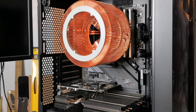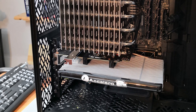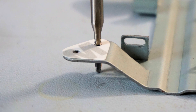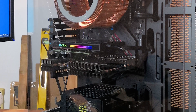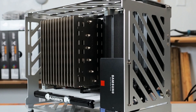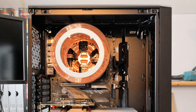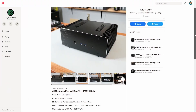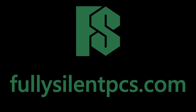If you can manage to find one of these coolers, it might be worth a try to pair it with a 75W graphics card and zero fans. The Arctic Accelero S1 is a 15-year-old cooler that is not compatible with any modern cards, but luckily its mounting bracket can be modified without too much difficulty with a drill press and tapping tool. I hope this info is at least interesting if not useful, and that the cooler companies can bring back aftermarket GPU coolers. It would be great if one or two could be designed for passive cooling, ideally with a sliding mechanism for compatibility with a wide range of mounting hole distances. Let me know in the comments if you have any experience with an aftermarket GPU cooler. Thanks for watching — consider joining my Patreon, and visit FullySilentPCs.com if you're interested in purchasing a custom-built fanless PC.